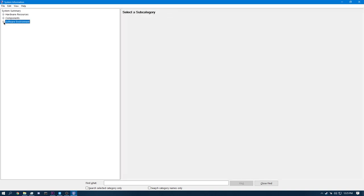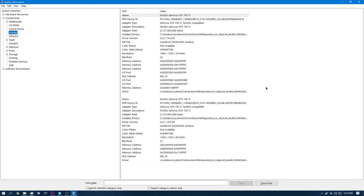There's my Hyper-V virtualization stuff — it's got all this crazy virtualization capability. There's my displays. I'm running dual 750 Ti's — they are not running in SLI. The reason is these 750 Ti's don't have SLI connectors, and even if they did I wouldn't want to run them in SLI because I'm driving six monitors and each card can only handle three at a time. I'm pretty sure Kepler series cards don't run multiple monitors over the original specified one in SLI configurations.